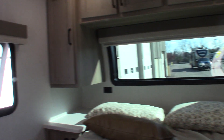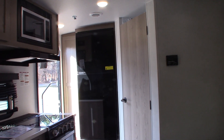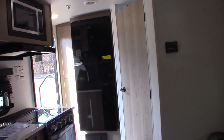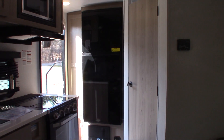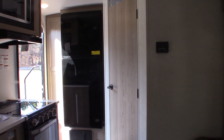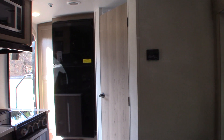I want to thank you for purchasing your trailer here at National RV Detroit. Please remember to inspect your roof regularly — that's important. You look for damage by low branches or road debris, cracks or separation at the sealant, any place water can get in. You can't see what's happening unless you're up on the roof looking at it. Right now this is winterized — all the water has been purged from the system and replaced with antifreeze. Your water heater is bypassed and empty right now. Always make sure you fill the water heater tank before you turn on either the gas or the electric. Thank you.